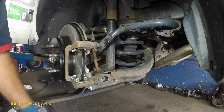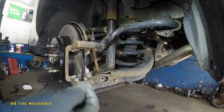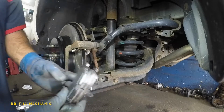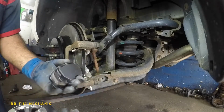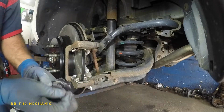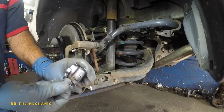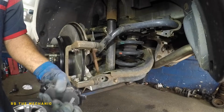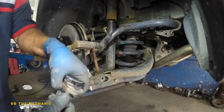Got the brake pads, but there's a piece that's gonna be in the bag that looks something like this. Take that. You see the brake pads? When the rotor turns in the bottom, that's where you want this at. On the inner brake pad in the bottom, you take this guy. You cannot put it this way, okay? It's gonna hit the rotor, so it's gotta be facing this long edge. Gotta be facing on the outward of the brake pad.